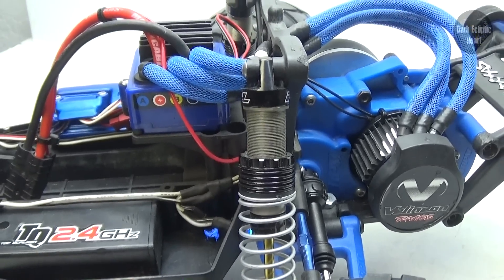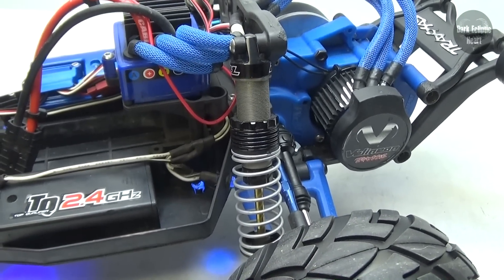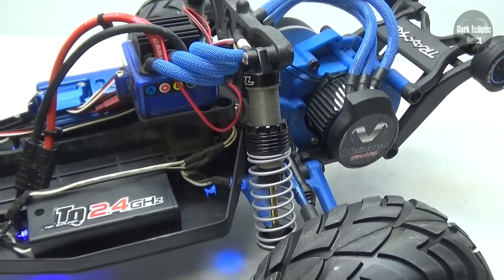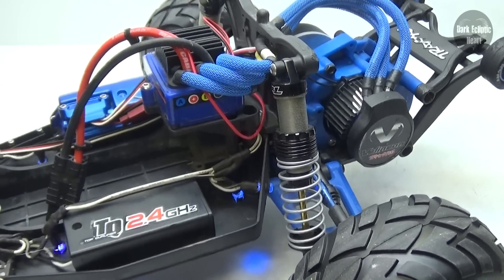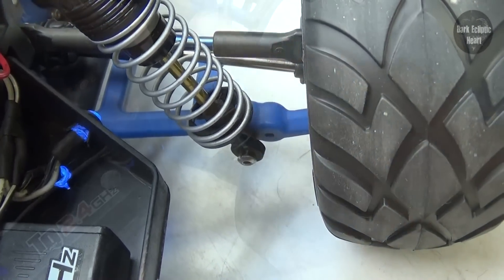The adjustable ring is nearly all the way down and the black spring on top is completely compressed. There is no progression in these shocks at all. So I need to go ahead and get these springs switched out, and it's going to be a very simple installation.